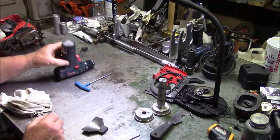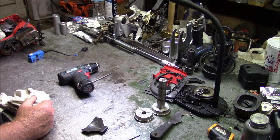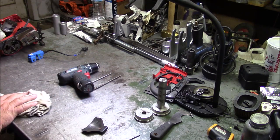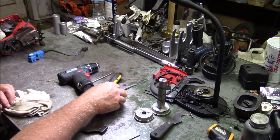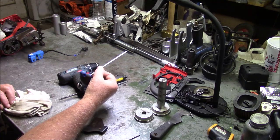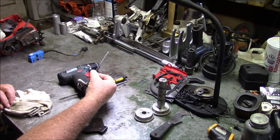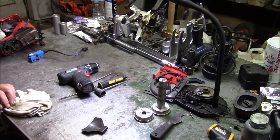And because I'm old, this, along with a... See, I'm still getting stuff together. That helps. Screwdriver. You can use these two bar nuts to get the cover off. If you take the muffler off, you got the 5mm to get it off the cylinder, although I'm not going to take the muffler off. Same with the carburetor on some of them, the Huskies, you got the smaller 3mm. So in this job, these are going to be off to the side.